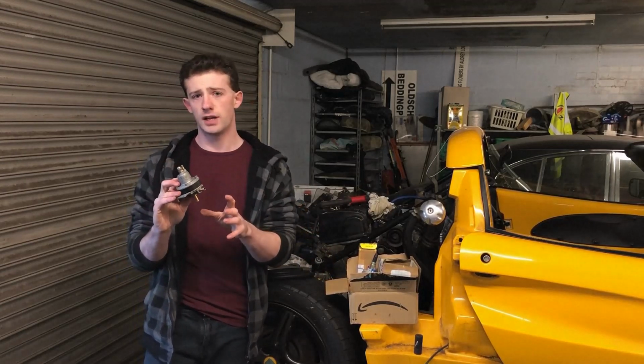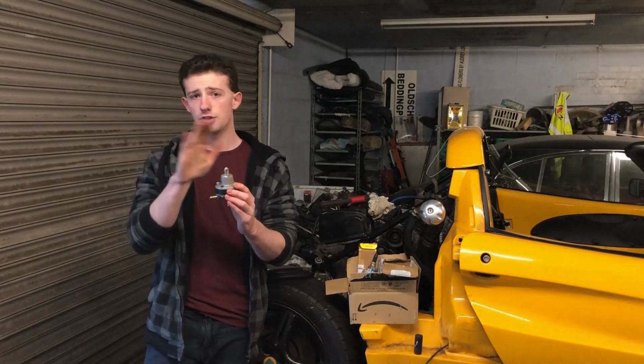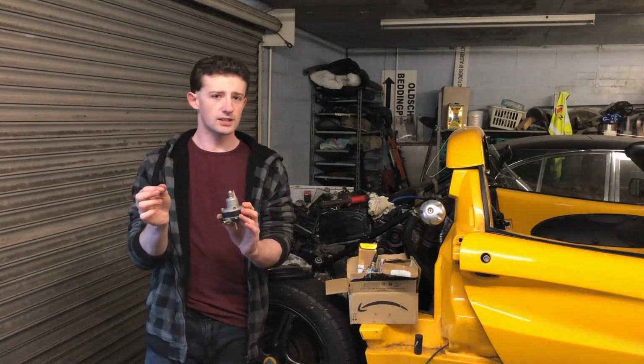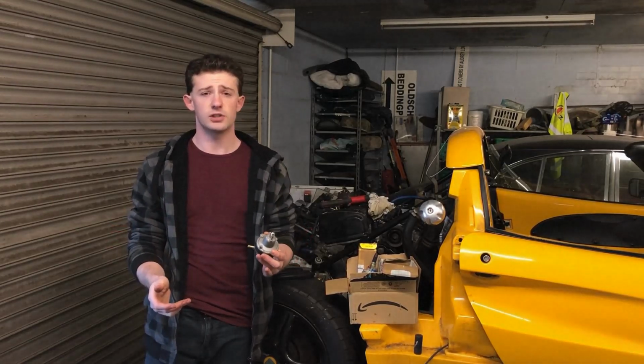However, interestingly, this is just a rising rate fuel pressure regulator under a different name. So what I can do is, instead of connecting this up, which is the thing that changes the pressure, because the Honda ECU does not like that, if I leave that disconnected and adjust this to 3.5 bar atmosphere pressure, this is just a 3.5 bar fuel pressure regulator, and it'll do the job for me. I think. I could be wrong. We'll find out. Shall we?